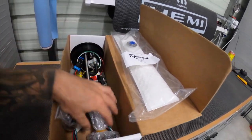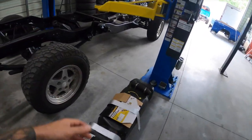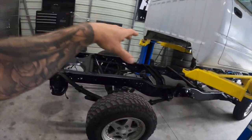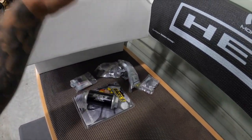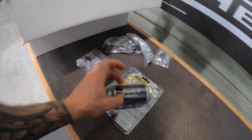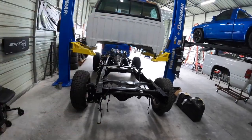The hydromat will go the length of the tank. The pump comes with a new gasket and all we need to do is use our existing locking collar on top of the tank — it will fit right in. We also have Earl's fittings to get all the plumbing done, as well as our Earl's high-flow fuel filter. I'm waiting for the mounting brackets, but we can get an approximate position for the filter, set the cab back down, make sure we're not going to interfere with anything, and plan our route.